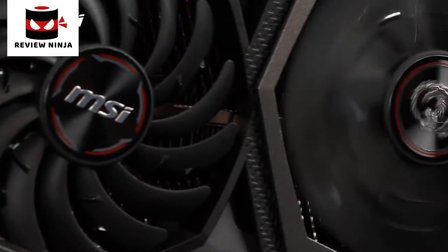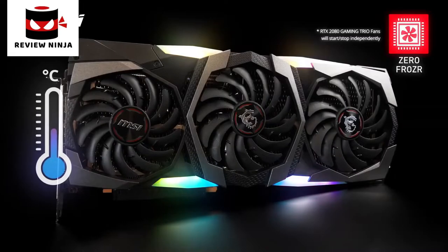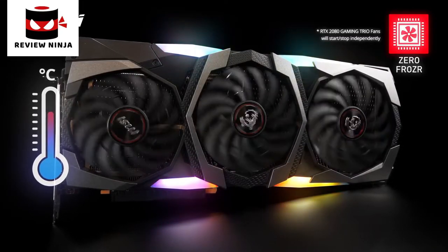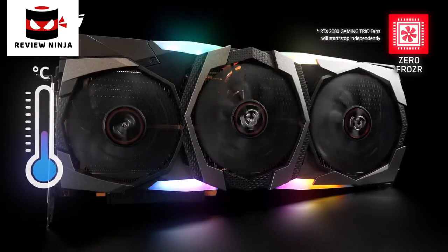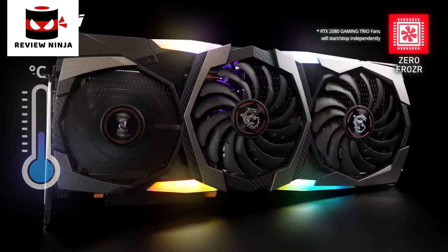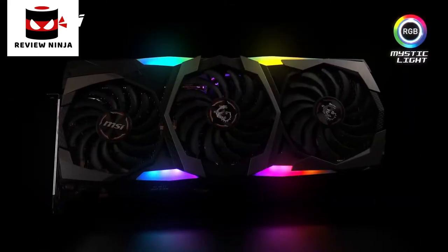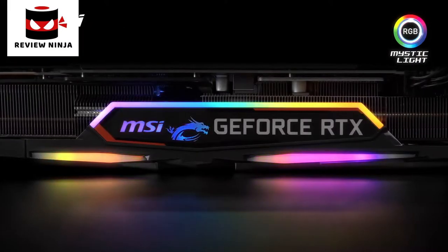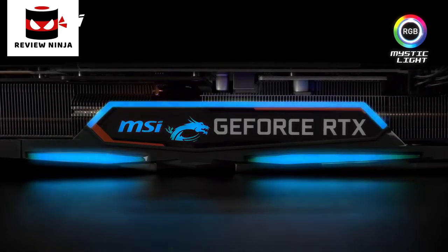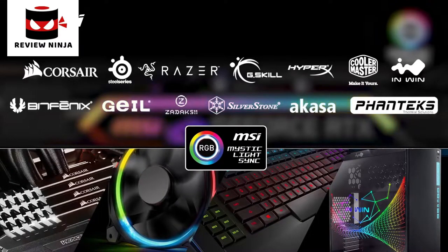At the core of each fan are double ball bearings that keep the fans quiet and are also very durable. Thanks to Zero Frozr, the fans will only start spinning if the card actually needs cooling. When the temperature drops under 60 degrees again after gaming, the fans will stop completely to eliminate any possible noise. The Gaming X Trio cards combine a black and gunmetal gray design with integrated RGB Mystic Light LEDs. You can fully customize your setup, choosing from millions of colors and effects, and synchronize these with other third-party products in your system using the MSI Mystic Light software.